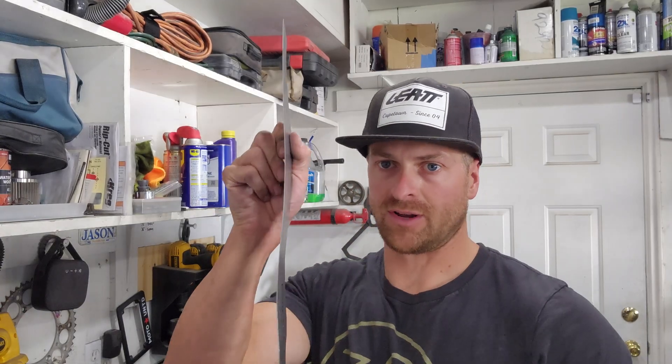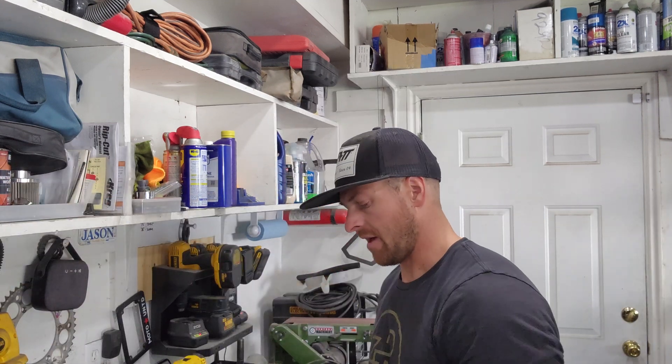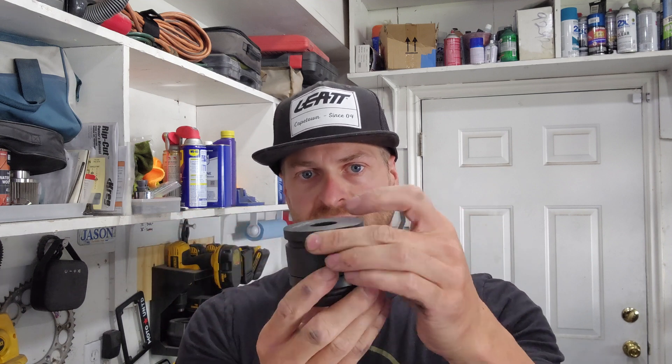A bigger piece of metal is obviously the way to go. You can see cutting it — I don't have a brake here so I just cut it out with a pair of tin snips and it makes it uneven. I have a solution for that and that is going to be dimple-dying it. It uses two halves — it's kind of sloped on one end and sloped on the other end, you put a piece of sheet metal in between the two. Usually you'd use a press but in this case I'm using a hydraulic ram, so it's going to pull these together instead of smashing them together — works the same way, just kind of opposite. That's going to add some rigidity to that plate. I don't need it to be super strong, it's just holding the coil packs in place, but the dimple dies will add strength to that plate and should straighten it out.